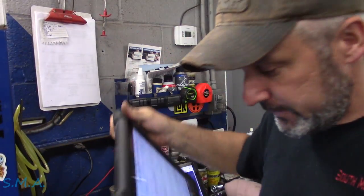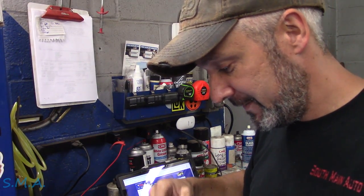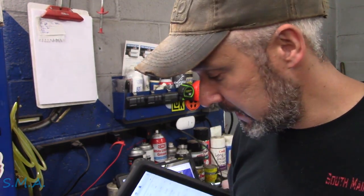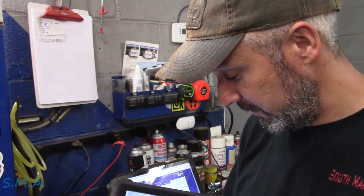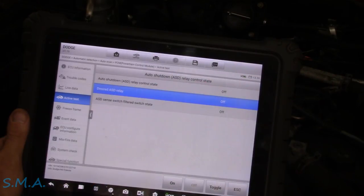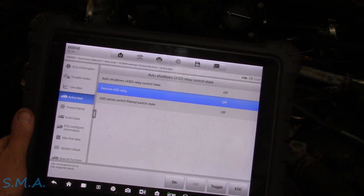I'm sitting here looking up data, and Jason made a good point telling me I'm an idiot — the crank sensors do not go into the bell housing on these. These 3.7s are the infamous ones that go on the side of the block. So I don't know what connector I was looking at in the back — just goes to show you can't always trust me. We had to put the battery charger on it; we've got it set to nuclear, the only setting a battery charger has around here.